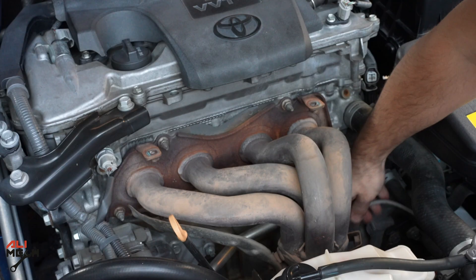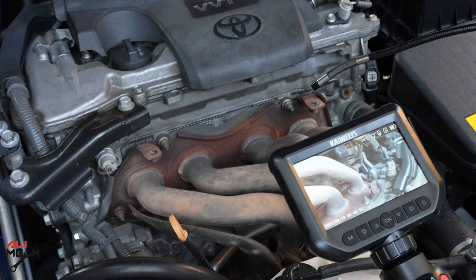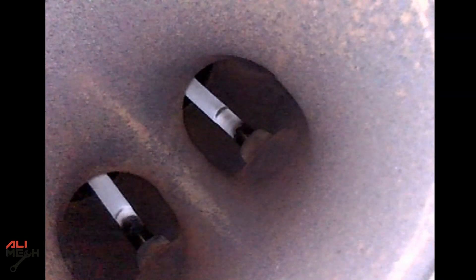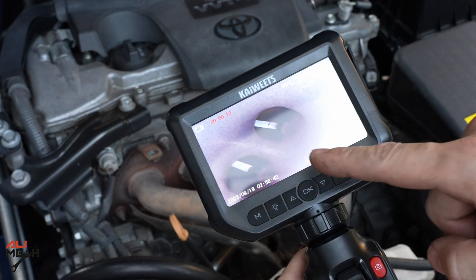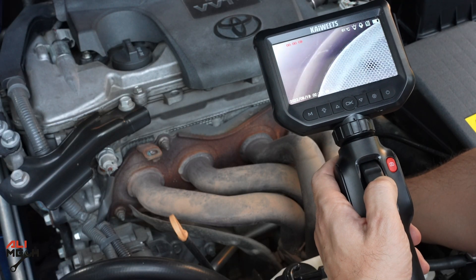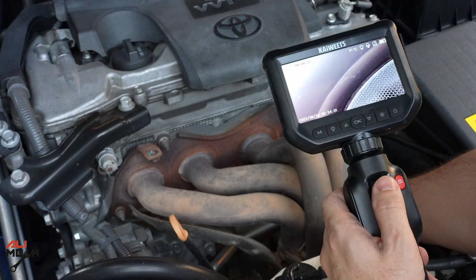The next challenge will be looking at the exhaust valve from the oxygen sensor — I couldn't do that with other endoscope cameras. We're going to put this to a test and see if we can reach the exhaust valves. We finally did it — I couldn't do that with any other endoscope camera. We could go through the oxygen sensor all the way to the exhaust valves and here we can see the exhaust valve clearly. The video quality looks very good and it's very bright. Here is the catalytic converter and we can see the edges. I can see a part of it is broken here, but overall it looks very good.